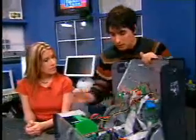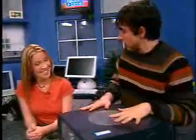That's all installed — you're good to go. At this point you can just close your computer case. You're not done yet though. Once you get this far, you go into your BIOS — we have instructions on the website. You basically just define the drive, then you format it, and then you have all that extra storage and you're good to go. You've just added a new hard drive. I think people think opening up your box and installing things is more daunting than it actually is. It's the first time you do it you're scared you might break something, but if you take your time and read the instructions, it's really not that hard.